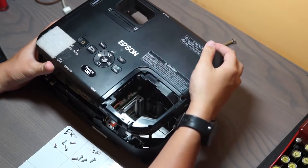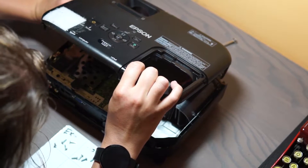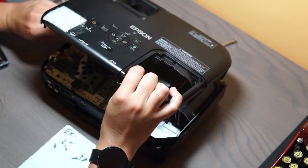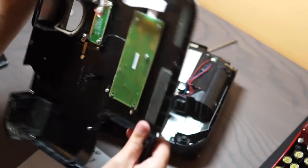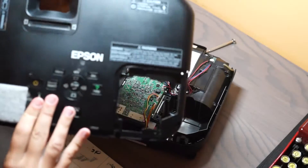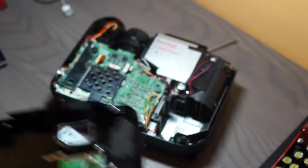Now there are some things that you have to note. There are two PCB connections here — you have connections to the main PCB and you're going to want to remove them from the main PCB. One of them is a ribbon cable. It might have a ZIF variation with a little plastic thing that secures it — just pop that up and pull it out. One connector is for the controls and the other is for the HV controller. This is for the controls on the top, the power button and things like that. Once that's disconnected you can go ahead and put that aside.